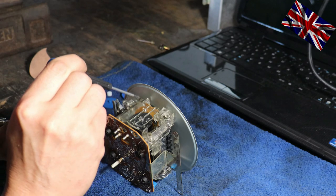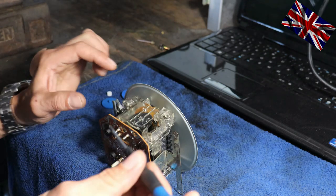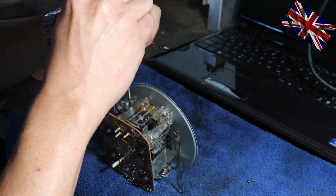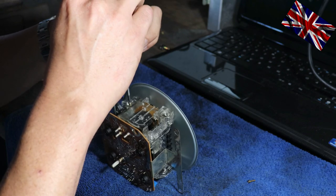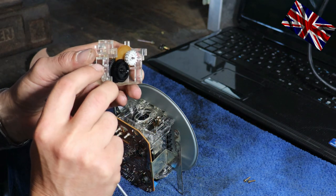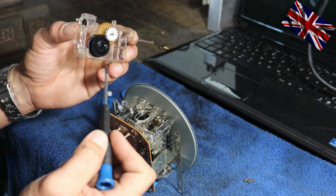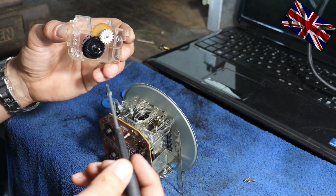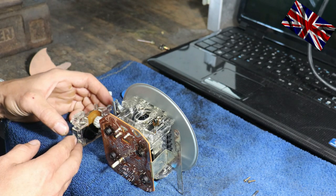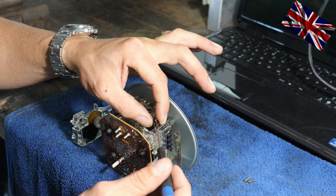To get to the broken cogs, this transparent protective cover needs to go. It is being held in place with two screws. I suggest you make a couple of snapshots, otherwise you will not remember how and where to put the right cogs in the right place. At the small cog, two teeth are already missing, no surprise it does not engage anymore.